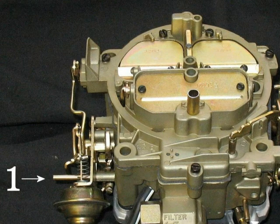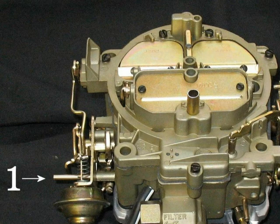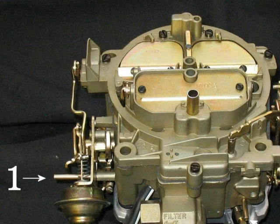Hey everyone, I just wanted to show you that photo of the car. Number two is the PCV valve — that was the hose that was not hooked up. It was flipped off to the left of my engine area, and because of that it was just starved for fuel because so much air was coming in through the vacuum valve. So make sure you get all your vacuum ports hooked back up the way they were — take pictures, take videos, whatever you need to do — and hopefully your rebuilt carb will behave so much better, and you won't have the mystery that I had trying to get my carb to run properly. Take care and happy RVing!